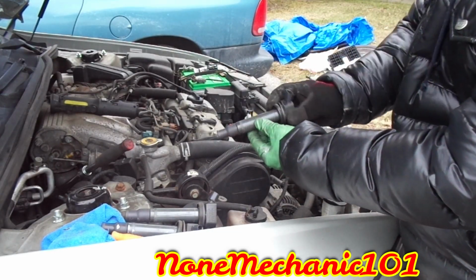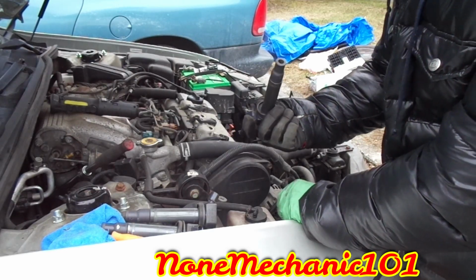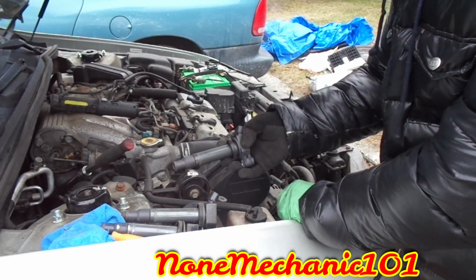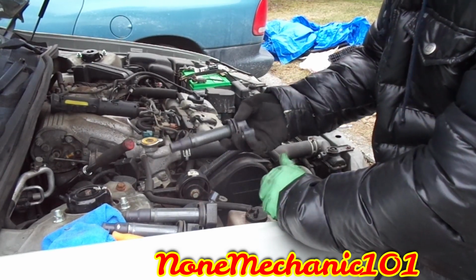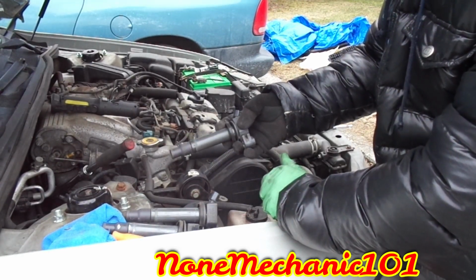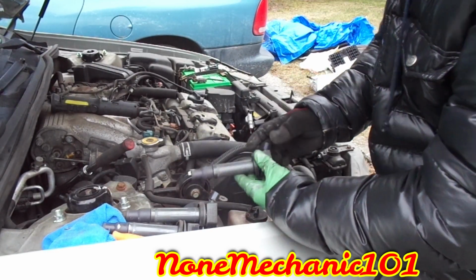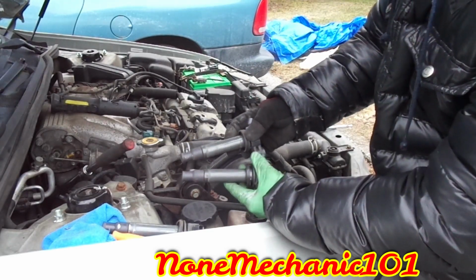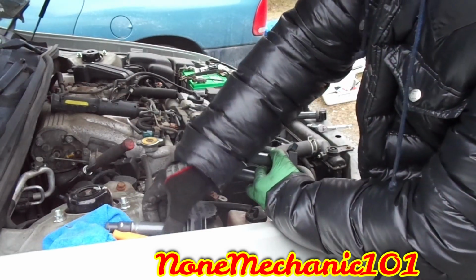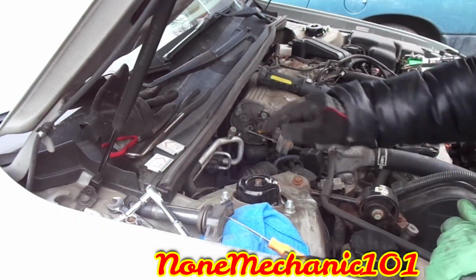They all crack right here. Now I want to know from you mechanics, would that make a difference on a P0303 or whatever, a coil popping up? You know these coils are expensive. Now I got to choose my poison. Which one do I put in the back? They all crack. All right, so we're gonna put the coil back.